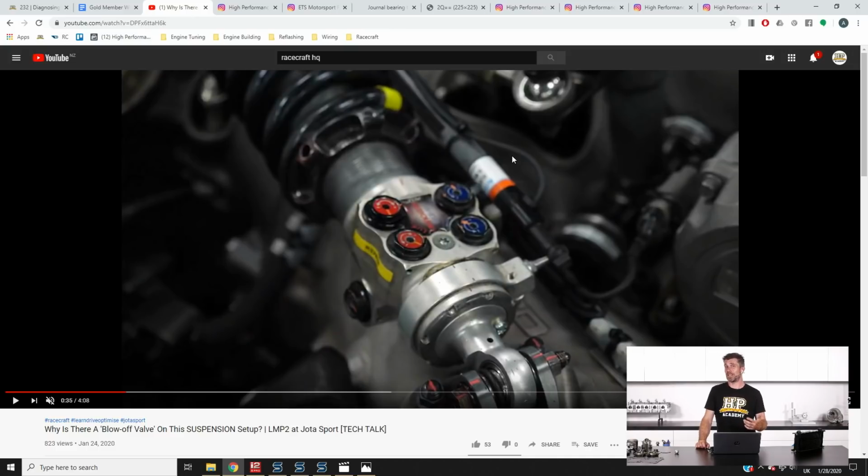If anyone watches the Australian Supercars Championship, we're quite often used to seeing these cars well and truly up on two wheels on the very large curbs that they put in purposely to slow the cars down on some of the street tracks. Now that's not going to work quite so well if you're running a LMP2 prototype car or the likes of an open wheel race car, a formula car. That's going to really upset the car and the balance, and basically normally it's going to shoot the car off the track backwards. There are certain areas though where in order to get a faster lap time, it may be inevitable that running over a certain section of curbing or ripple strip is essential to actually straighten out the track.